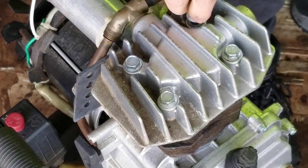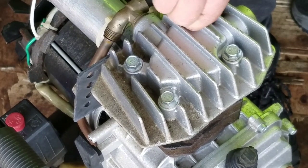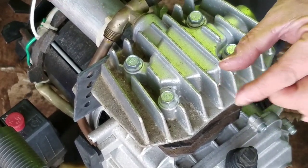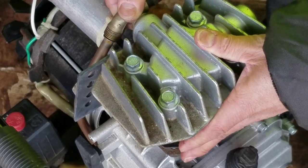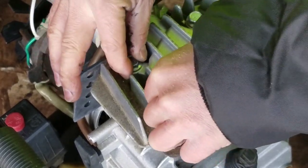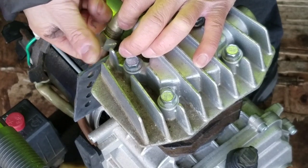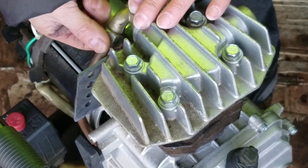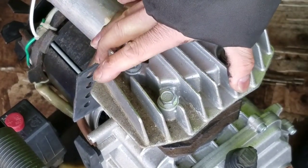It's going through the threads just fine and tightening down. If it doesn't tighten, it means you probably caught the bolt on part of the gasket, which is no good — you'll rip the gasket. Move it around a little more, make sure they're all freely moving. As you tighten the bolts it moves less. Now we're going to secure this part. This really isn't very tough to do. I'm going to torque down these bolts.